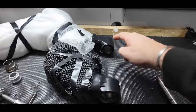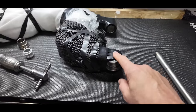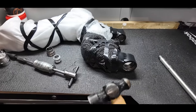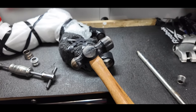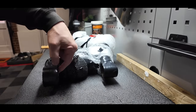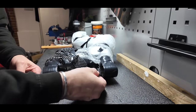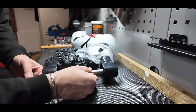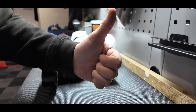The manual says to heat the swinging arm to 150°C, but because it's got powder coat finish I don't want to damage the paintwork. So I'm going to use frozen bearings and hopefully they go in without too much persuasion from my improvised Ducati special tools — my only real Ducati special tool being the chisels. The plan is to fit the bearings on one side first, then use the spindle to push the bearings in on the other side.